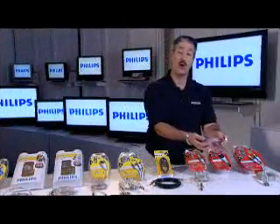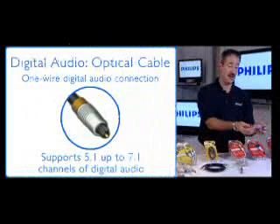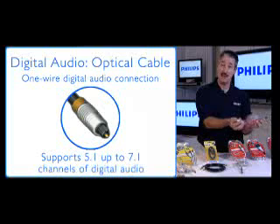The next connector is called the optical cable. It delivers the same high quality audio as the digital coax. The optical output on the back of a set top box may have a little beam of red light. You plug this into that light, find the digital audio input on your TV — though more than likely it will be an AV receiver — plug those in, turn them on, check the manual and settings for correct configuration, and you'll get great audio up to 7.1 sound.